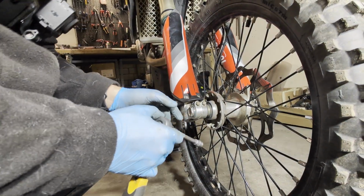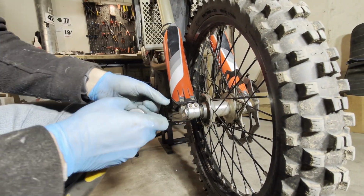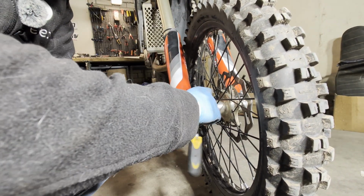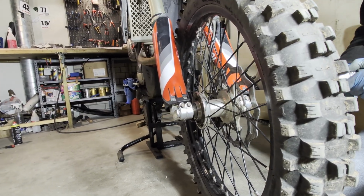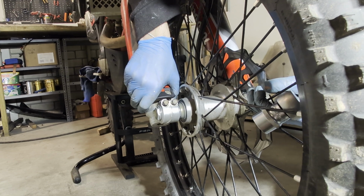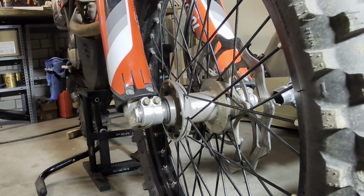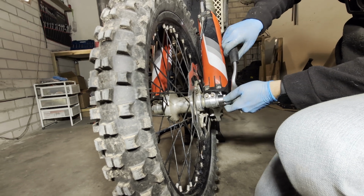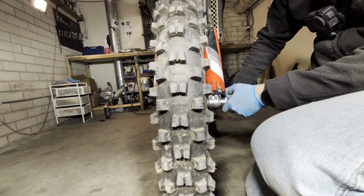So next we're gonna adjust the left fork. It needs to sit perfectly aligned. So what I'm doing usually, I need to unscrew those two again. Many people put the bike on the ground and punch the suspension until the left fork adjusts how it needs. But my method is a bit less brutal. For example, if you squeeze it, you can see that the alignment is bad. What I like to do is just screw the whole axle clockwise, and this way the other side centers itself. So you don't need to push the suspension on the ground, etc.